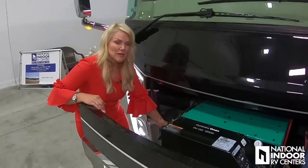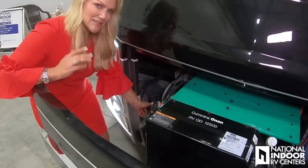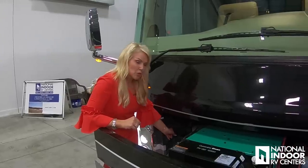Down here I want you to notice the dash AC air condenser fan. This is significant because you only need five feet of hose to run the freon up to the AC in the dash. Most other manufacturers have this in the very back of the coach, so they have to run 50 feet of hose to warm the freon as it travels. You can also see your air horns back here.